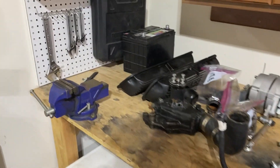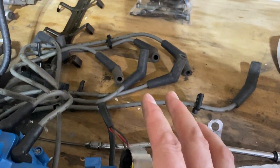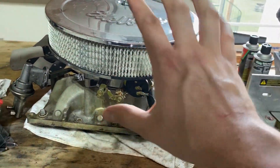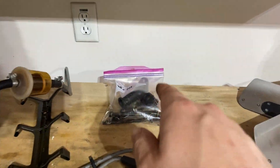Let's hit pause on the time-lapse because there are a couple of interesting things I found as I was diving through this. First things first, I highly recommend getting a lot of space on your workbench so you can lay everything out. I always like to try and keep things together as best I can - basically if you don't have to take it apart, don't. Why take the carburetor off? Leave everything connected if you can, and bag and tag everything.